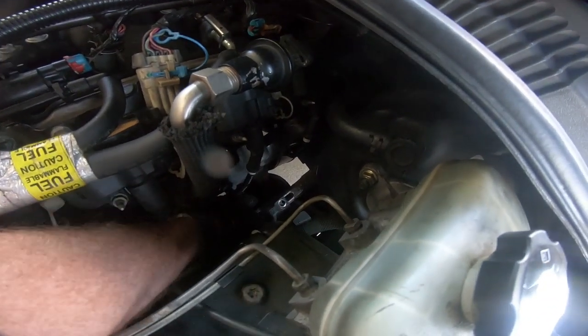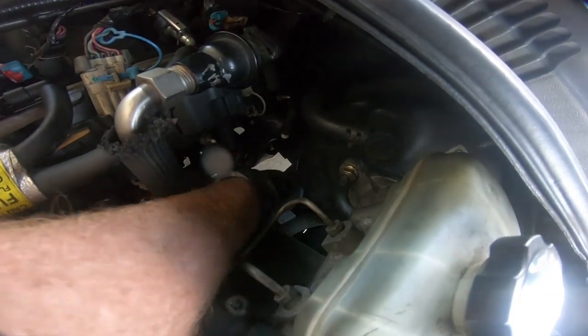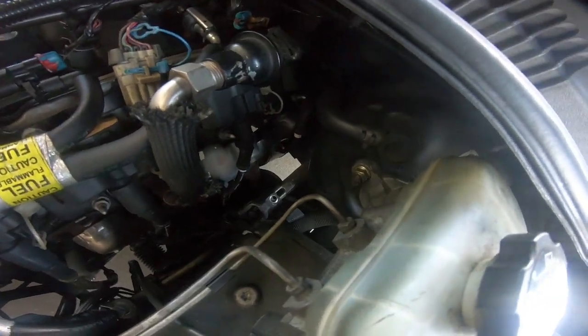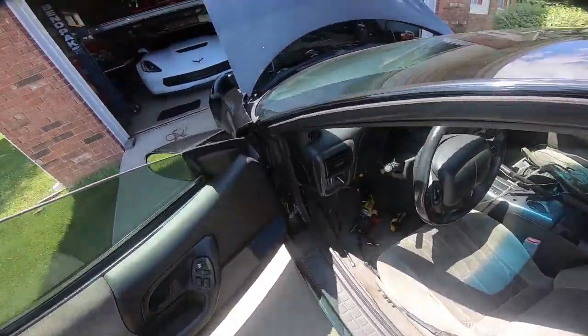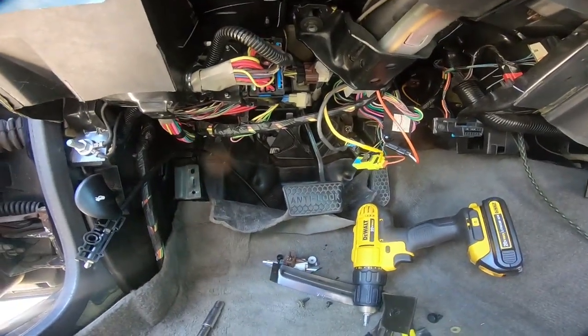Now, once you have this into place, we'll have to push it in. Obviously, it'll push a little closer once we get the steering column up against the actual firewall. But it is on there. It's just a little bit harder to do that with the bottom not loose. You could loosen the very bottom of that joint out there, and you could maneuver it around. But I've gone ahead and done that.